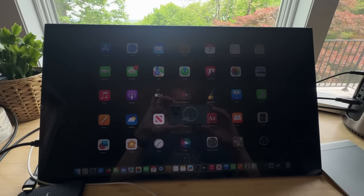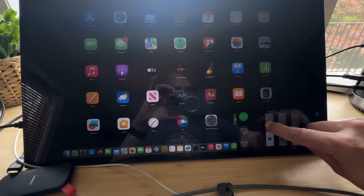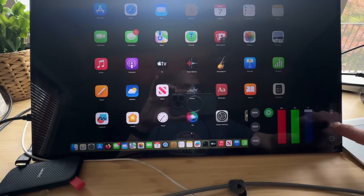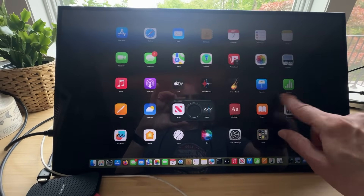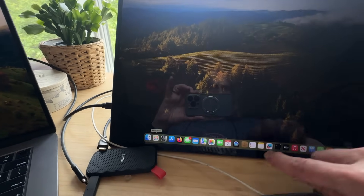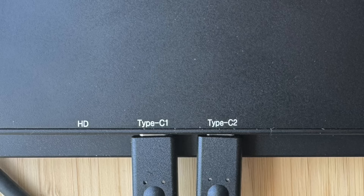One thing I learned the hard way — because it's not in the manual — is you have to connect the monitor to your Mac and then boot it up. If your Mac is already on when you connect the monitor, you're not going to get any touch functionality. It needs a cold boot with the monitor already connected, and then touch and display work together over one cable. I'm running off my MacBook Air's battery and was able to get touch and the monitor working together, so it is truly a portable monitor depending on whether your computer provides enough power. If your computer needs more power you can use the power adapter connected to the second USB-C port, and connect your computer to the first USB-C port.